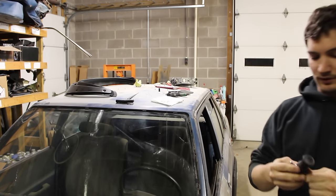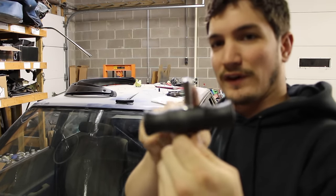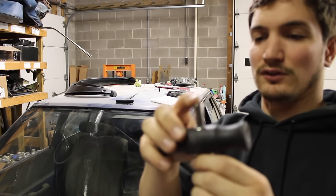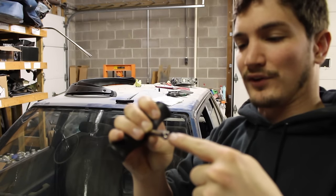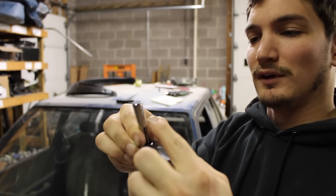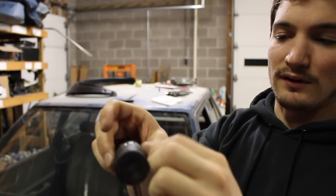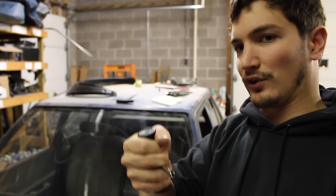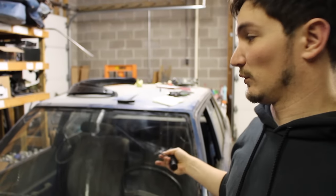Now that the cable is out, there are two T-handle pieces, each with a floating bar in the middle. The bar has a fat side on top and a skinny side with an E-clip. Thread the cable into the hole on the side with the E-clip — it'll come out the side — then thread it into the little hole up at the top, pull down on it, and the extra cable inside the T-handle will tighten down. That allows you to put force on it so you can saw the two handles back and forth to loosen up the glue and pull the windshield out.